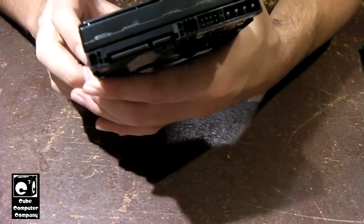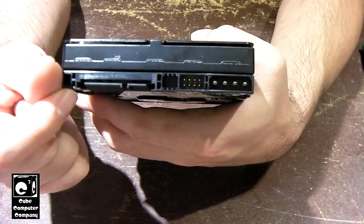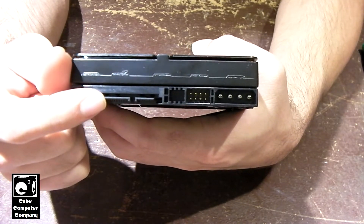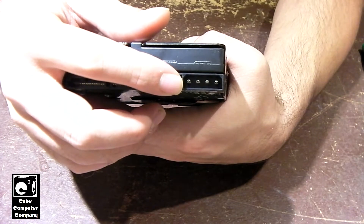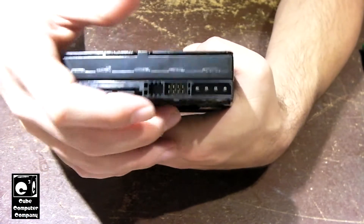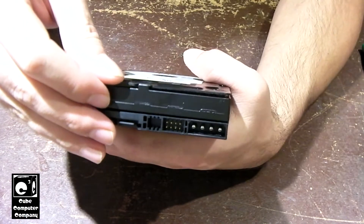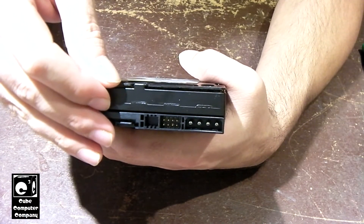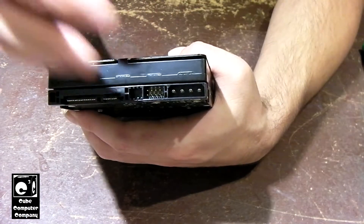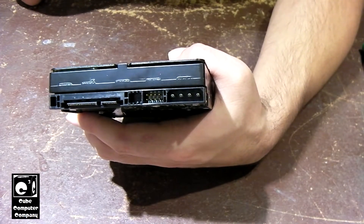The reason why I say early is because you look at the back of it — well, the drive is from 2006, so we are talking about the early years of it. You can see here we have a SATA power connection, but also a traditional 4-pin molex connection that you would have on older drives, like IDE drives. This was from the era when these drives were new and a lot of power supplies out there were still lacking this new connector, so you could still use an existing power supply without having to use an adapter or modify the output cables.